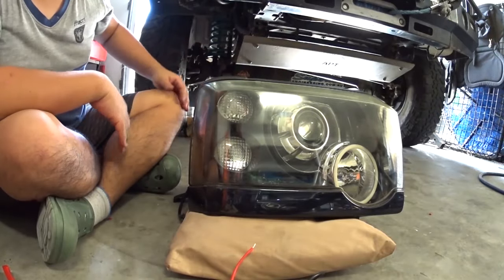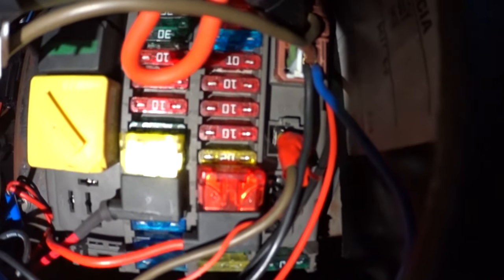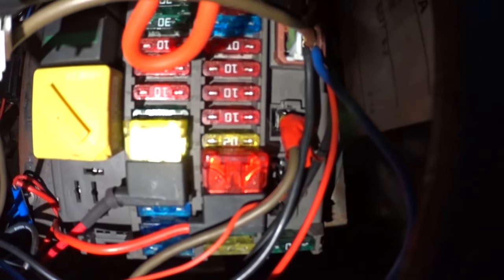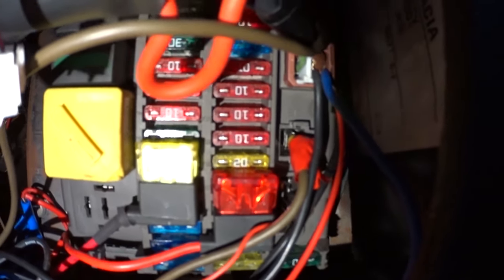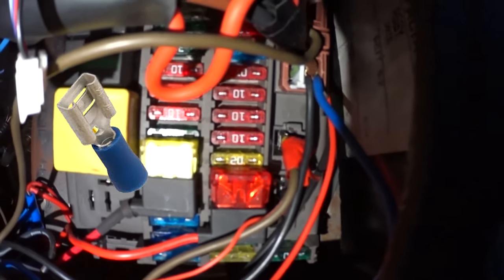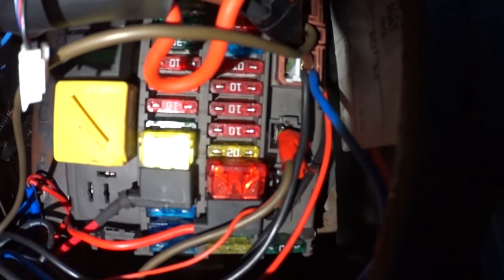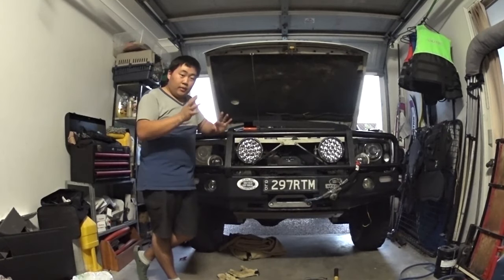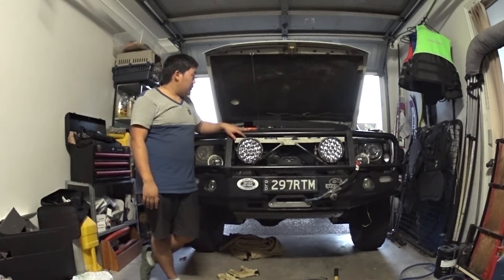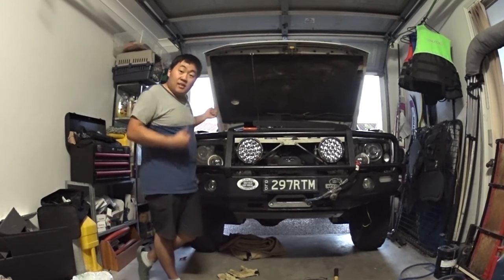Let's go get this bad boy fitted to the car. So where that brown plug is — right there, with the brown plug with the red tape — when you look on your car it'll look like a LAN plug for internet. That's the plug you want to plug into. It'll take a normal female blade. Plug that in and that will give you power for ignition on only. I figured out my old wiring, rewired it to work with these new headlights, and plugged it in. Hopefully it works.